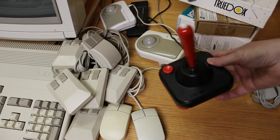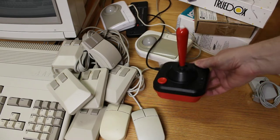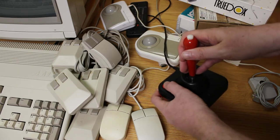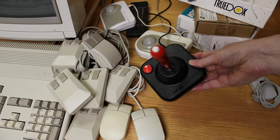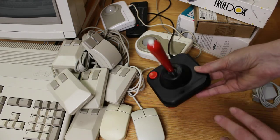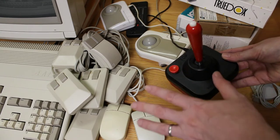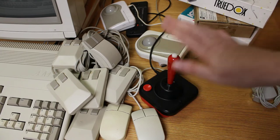Of course, I'm sitting here talking about mice — how about joysticks? This is my Wico Command Control. This is what they refer to as the bat handle. They also had one that had a ball on it, and one that had a grip where the fire button was on the stick. I'd never been a fan of having fire buttons on the stick because I just can't fire as fast — I could always do better with a button on the base for firing. This joystick was originally made for an Atari 2600 and allows you to switch the button input from base to stick. Interestingly, some Amiga games support two-button joysticks, and this one actually does work — for some games, it'll register the fire button separately.